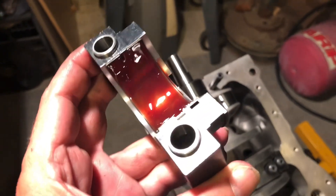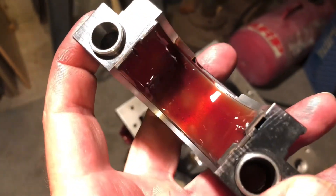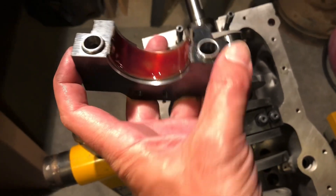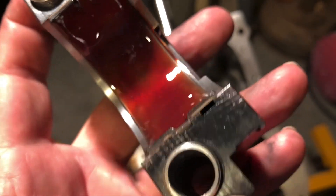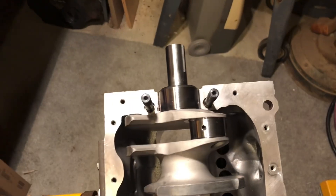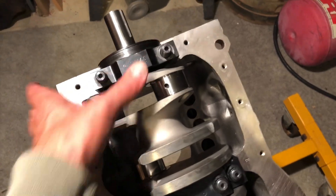Most of these high performance A-Series engines, especially when you replace the bearing caps and have an option, you see how this cap here has a dual notch arrangement. We have the center tang style A-plus late bearings. These started with the ERA turbos - they decided to do away with the groove down the middle of the main bearing, the idea being this is the lower side when it's holding the crank, and doing away with the groove increases the surface area. Hard to say if it really makes a difference, but when there's an option, most of these caps will have dual notches to allow you to use either the early bearings or the late A-plus slash turbo bearings, as we are in this case. We measured our clearance at just under one and a half thousandths - a nice number for all brand new parts. Let's continue with our assembly and we'll try to show interesting little details as we make progress.